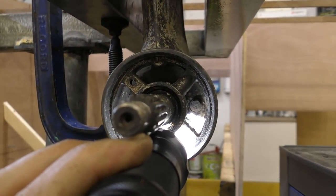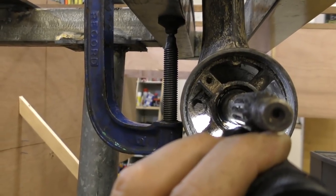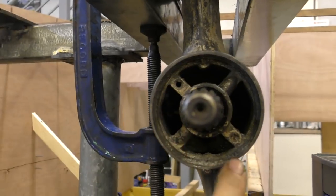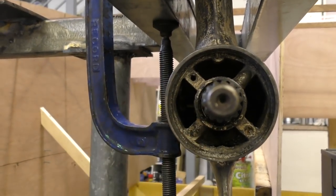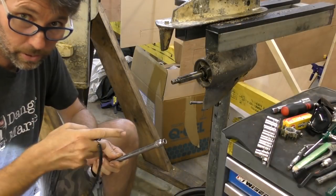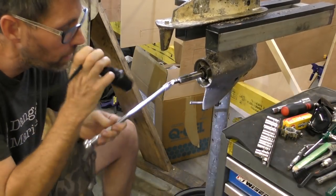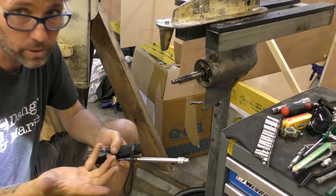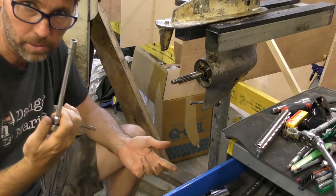Hopefully you can see there's a bolt head inside the gear case there on the right, and then there's another one there on the left. We need to get both of those undone, and then we need to clean these thread holes enough to put a puller into them, and then pull the bearing carrier out. The only imperial sockets I have are 3/8 drive, and they actually don't fit through the gap in the bearing carrier. So I'm going to use 1/4 drive sockets and use a metric one — I think they're 5/16 bolts, but I'm going to use an 8mm socket.